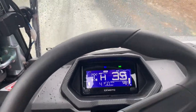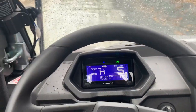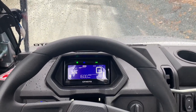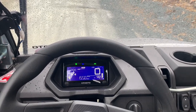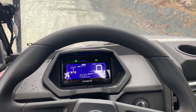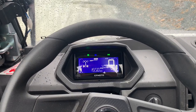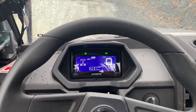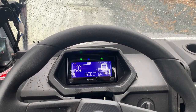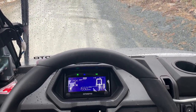It's a really good balance. When I was running the full RNG setup with 12 gram weights, the revs were a lot higher and the performance was better. I know I like the compromise between high RPM performance on some trails and smooth cruising on others. I'm going to stick with this for a while. The only thing I may do is put the RNG secondary spring back in because I like the back-shift better, but this is a pretty good RPM compromise. It's a utility machine, not a sport machine, and we'll keep you posted.